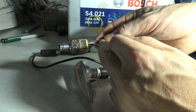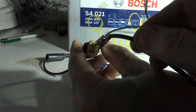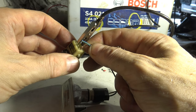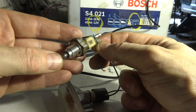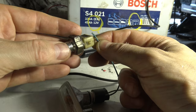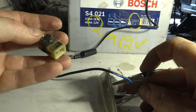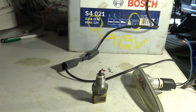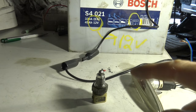I have to connect this cable into the other slot in that way. Now there is no light, but look - when I press this button in the switch, the light comes on! This means that when I press with my thumb it means reverse gear is on, and this sensor is okay. This is the way how it works, and in the same way you can test your own sensor. Thumbs up if you think this is useful, see you in the next video!